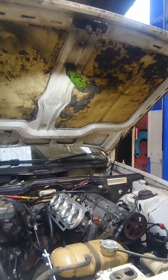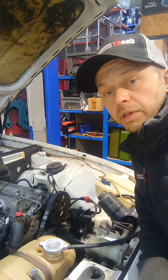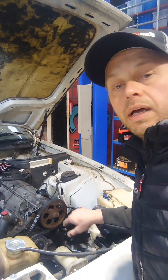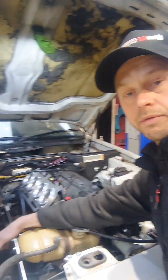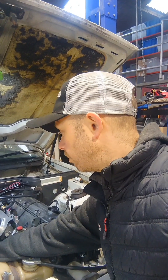I wanted to cover the main aspects of the throttle body kit and the management kit — so the ECU and all of that — and the trigger wheel kit that we also offer on our website. We've got a typical 2 litre 924 engine with a set of our 44mm ZX10 throttle bodies and a fabricated inlet manifold, all available on our website. It's got our coil pack setup, a set of ignition leads, and our fuel pressure regulator. That uses the existing pump but puts one of our adjustable regulators on there to get you down to 3 bar fuel pressure.